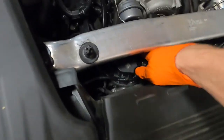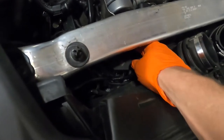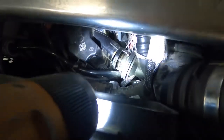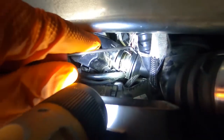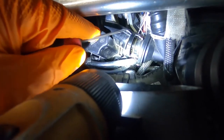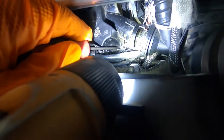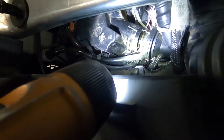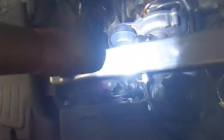I'm going to try to squeeze this clamp loose here. A little trick for that — very carefully, you see that there? Very carefully slip this down here and pry this way. Just be careful, because if you put pressure on it too much in any direction, you may break it. So be very careful. If you don't feel comfortable with that, just take this all off and you can rotate the pipe and get better access to those two plugs.